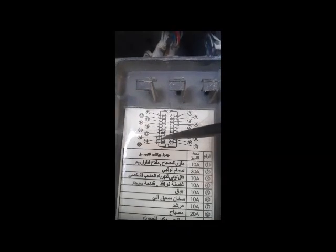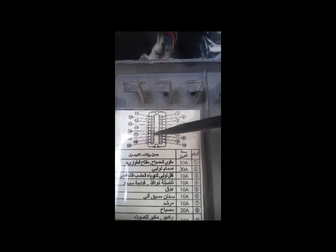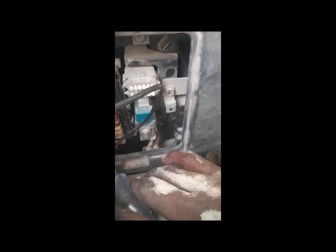Back in the cabin, here is the fuse box. The labels are written in Arabic but I referenced the wiring diagram. Fuse number 17 is in the second row — positions 11 to 20 — and counting from the bottom it is the fourth fuse. I checked and voltage is now coming to fuse number 17.